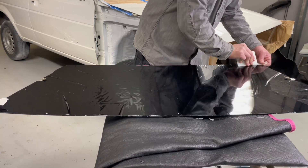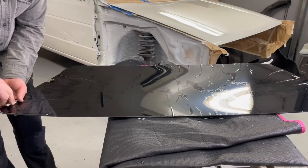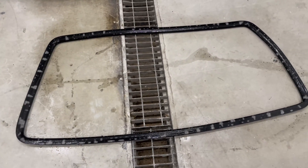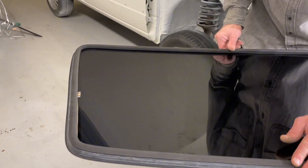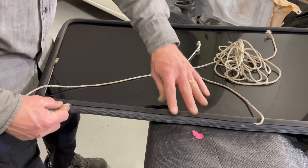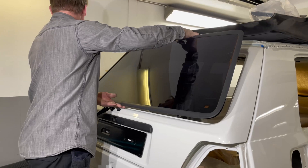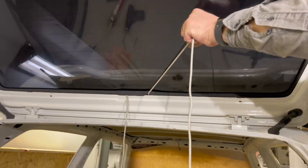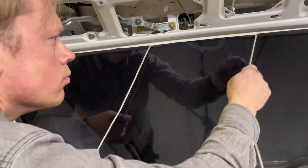This is always hard — I don't know why, but I am not good at this. But in the end I was pretty satisfied with it anyway. Here is the sealing for the rear window and I am just cleaning it here. Now it's time to install the rear window to the car, and here I have a rope that I always use for this kind of work. It's important to always try to pull at the center of the window — it will make everything so much easier.